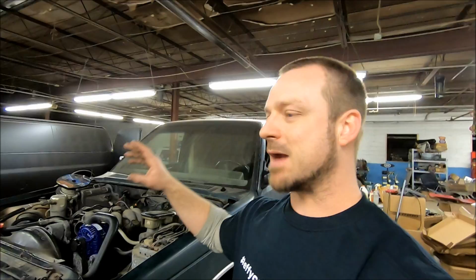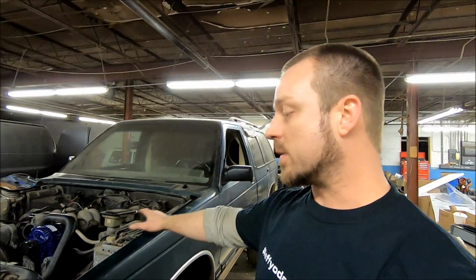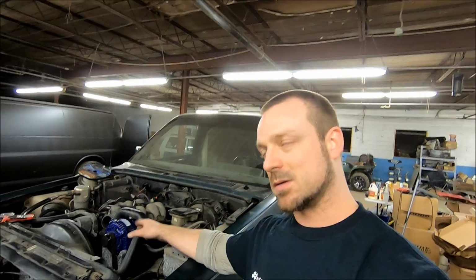If this was just a simple drop-in little 1500 watt system, you don't need multiple runs of wire. One run of wire is good for you. Always run the biggest, best wire you can afford to get in that car. You'll thank it later. But aftermarket setups where you've got an aftermarket big battery, you've got an aftermarket big alternator, I would typically always run two runs of power, two runs of ground. Always do that, because I treat everything like a power source. Battery's a power source, alternator's a power source, and I do one run of wire per.